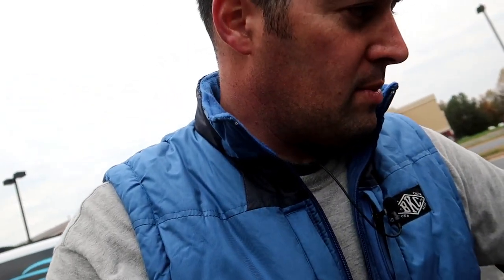Finish this Suburban. So we, again, we're doing our Stage 2 paint refinement service on this, and it's a regularly maintained vehicle, so it wasn't horrible, but it did benefit from it. As you saw in some of the before and afters, it did reduce the swirling and some of that light wash marring that this paint just has because it's very, very soft. So let's just go through and see some of the afters.